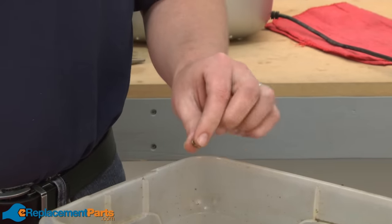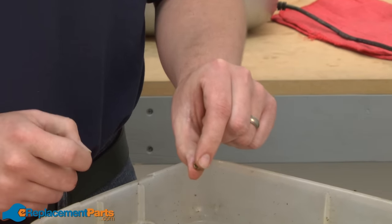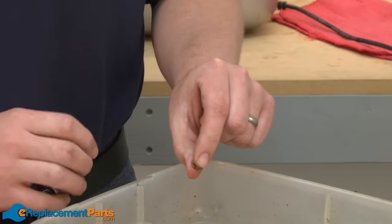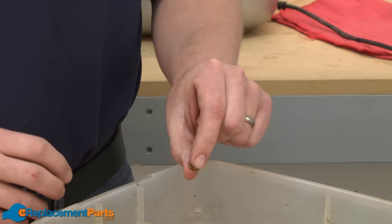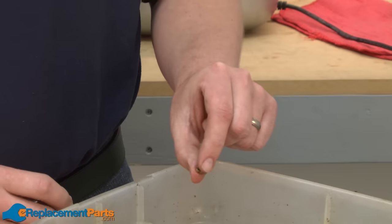One thing you never want to do when cleaning any parts of the carburetor is to insert anything metal through the small passages, as this will actually damage them and make it not work properly. You can use something like a fishing line though, that won't damage the metal components and works just fine.